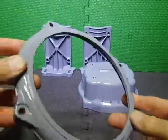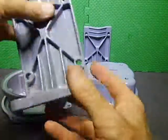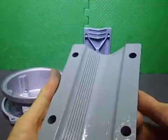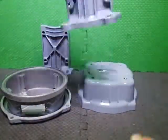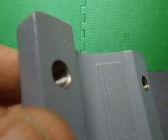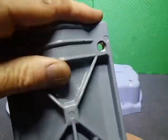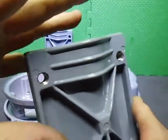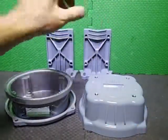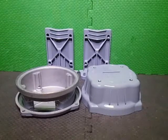The bearing ring has been painted as well and that's all been done with a slight shining up. These are the older style clamps - you have a threaded side and this is the actual bolt side. Everything has been glass bead blasted, etched primed and painted, and I've put M8 recoil inserts into this as well - four of those. I prefer doing it with these old clamps because stainless steel bolts in the old ones would react with the aluminium quite badly and sometimes you can't undo your mast clamp.